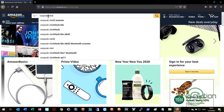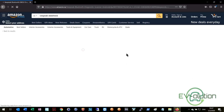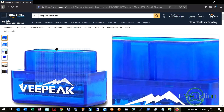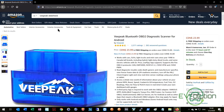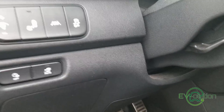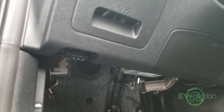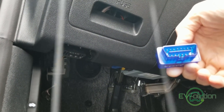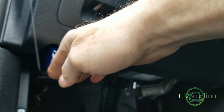In order to get the information out of the car, you're going to require two things. The first is a little OBD2 reader, and the next is software on your cell phone that links to it. Head over to Amazon and purchase the OBD2 reader — it's the V-Peak OBD2 reader, and I'll put a direct link in the description below. The OBD2 port of the Kia Niro EV is on the driver's side on the bottom left of the dash. When you look under the bottom left near the dead pedal, you'll notice a little connector — that's where the reader plugs in. Both the OBD2 port and the reader itself are keyed, so you can't put them in backwards or upside down.